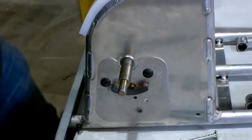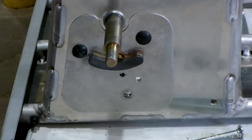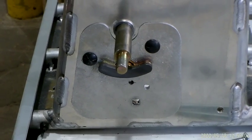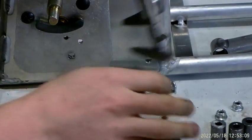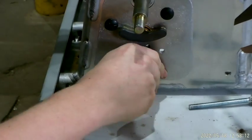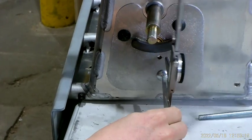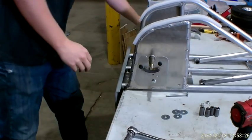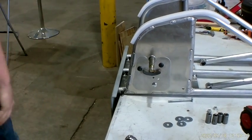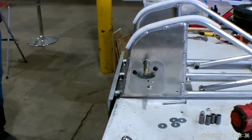Yeah, so the way I measured it was with the calipers. But essentially, everything pivots around your bolt right here. So I know that hole's supposed to be around 1 1/8 inches from center. So I set my calipers to 1 1/8 inches, and you can do it with a bolt in there, it's easier. And I just measure from center, and kind of engrave a little arc right there. It doesn't have to be perfect. I don't know if you guys have a pair of calipers or what, but if you don't, we can measure later.